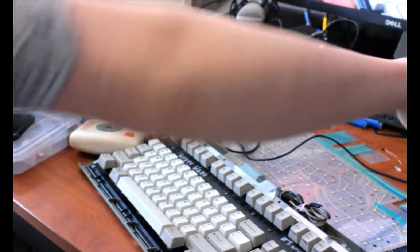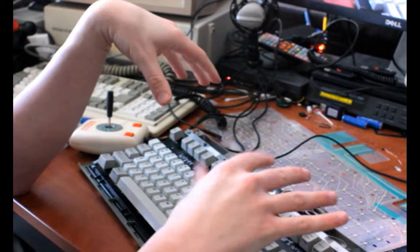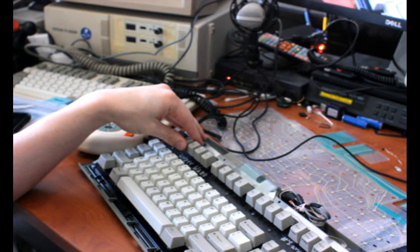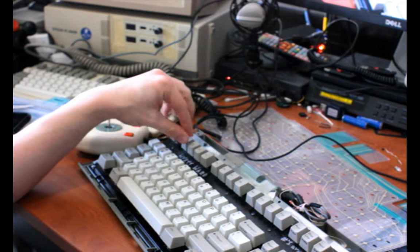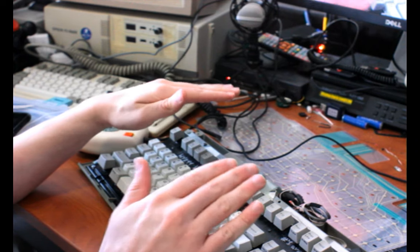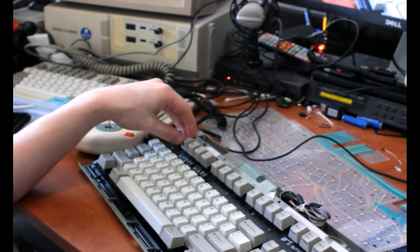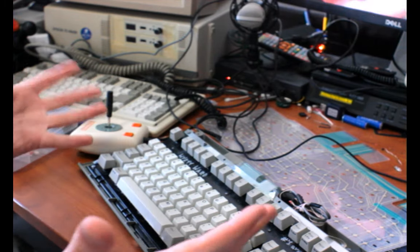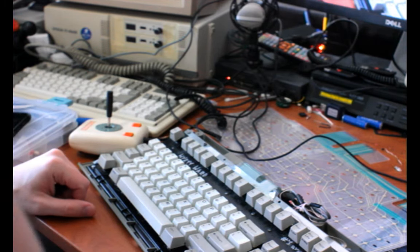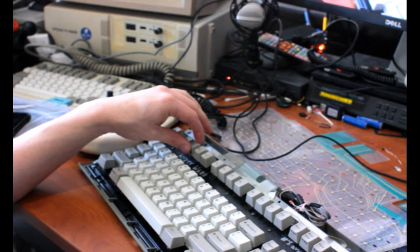But, yeah, so this board feels better than the others, in my opinion. And I felt this way even before I found out online that people agreed with me, so I'm pretty sure it's actually true. The keys feel smoother when you press on them. There's less of a scratching feel. Like, there's very little on a normal Model M, but there's even less here. And it feels like the keys maybe click a little bit at a different spot and more consistently. It's just a slightly better feeling board, and you'll have to trust me on that. I think the plastic material might have also changed because if you put Unicomp keycaps on one of these, it feels really scratchy.